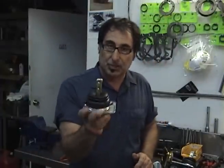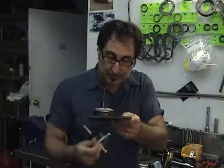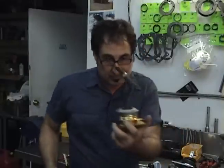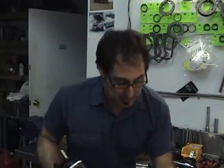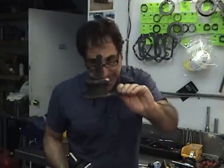There are many T5 shifters out there. This is a typical kind of GM short-stop shifter. This is something out of a Mustang — you see it's got a little bit longer base. This is an S10 Blazer one — you see the way it's got the S-curve to the stick. And this is one from a Jeep; this is what the Jeep ones look like.